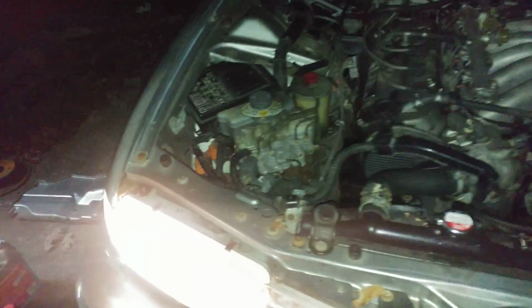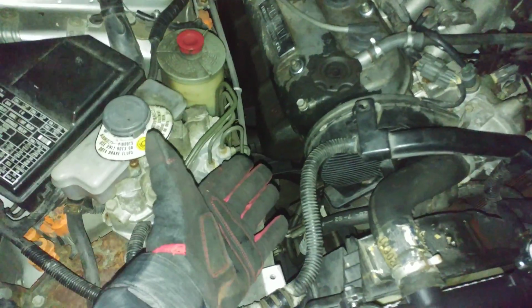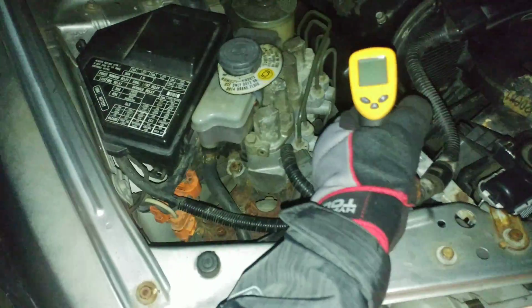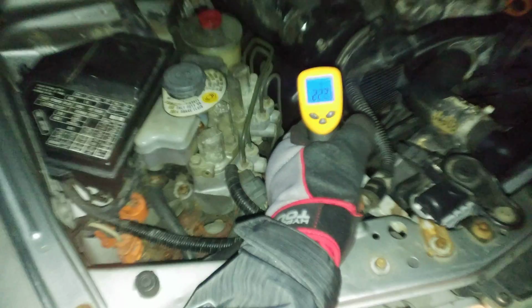So I've been doing this for about 30 minutes now. The oil has finally stopped burning off the exhaust manifold profusely. It's kind of there a little bit. It's kind of like a waft. I've been monitoring the temperature to make sure it stays away from the oil flash point, because I do not want an oil fire coming off of this exhaust manifold.